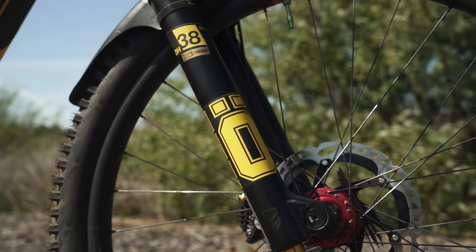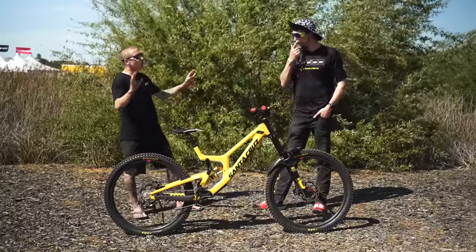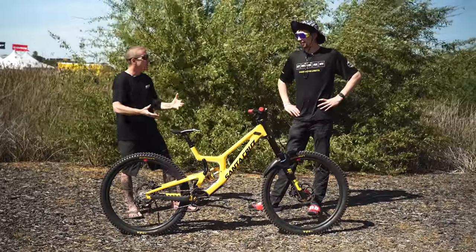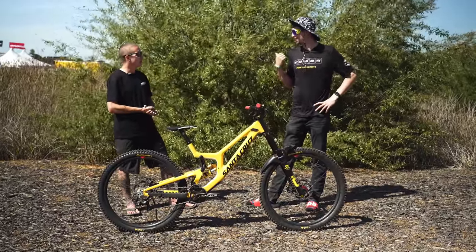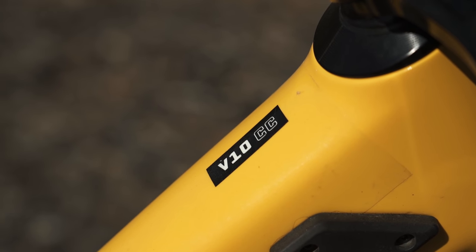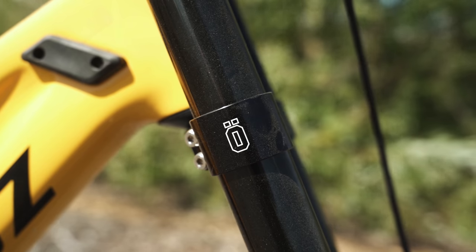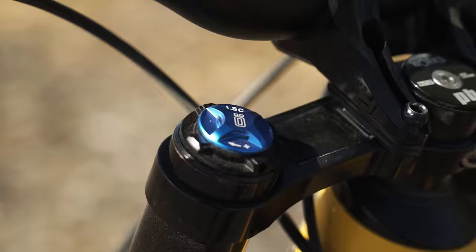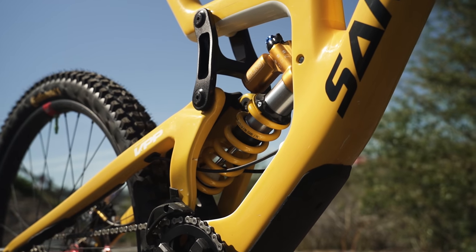Let's move on to suspension. The team is sponsored by Ohlins, but you've been a Fox guy for a long time. From a racer's perspective, are you nervous about the change? I ran Fox because a friend works for them and they're nearby. I actually get really excited by change — I've been known to get a race bike the day before a world cup and just run it. I'm really excited to learn the new Ohlins system. It's totally different — Ohlins is more damping-focused rather than spring. I've gone down 50 pounds in spring rate, which seems mad. I haven't even had a chance to ride it yet — we literally got it, stuck it on, brought it to the event, and I'm looking forward to going back to Scotland to test it.